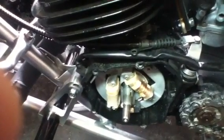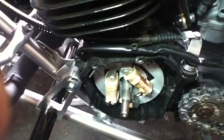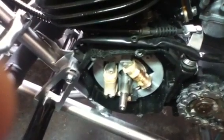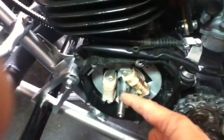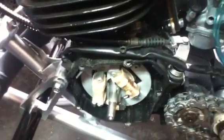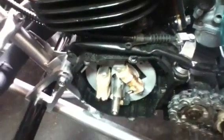This little tiny key will not hold the torque from your engine. So if you want to stop this problem from happening, it's very simple: grind it until it's flush and you've got a nice flush-fitting V-groove, then clean everything off. I use electrical parts contact cleaner that I pick up at the local hardware store or auto parts store. Put your flywheel back on and use the recommended torque. You don't have to go crazy — in fact you don't want to, because you'll never get that flywheel off or you'll break the end of your crank. Use the recommended torque, it's fine. Put a brand new Woodruff key in, and no more problems with your flywheel.